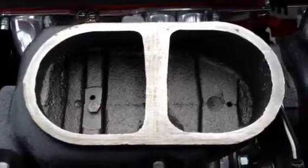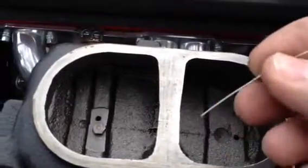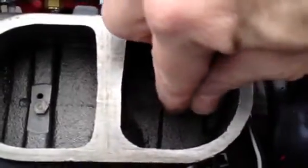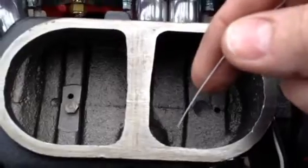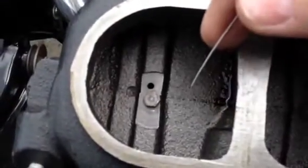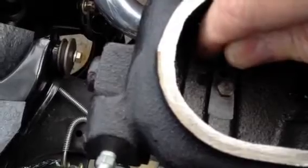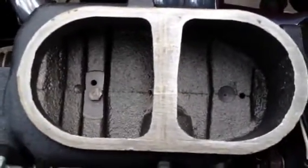So what you've got to do is if you have that problem, get a turkey baster and suck the fluid out of the master cylinder and take a little wire — it should be about 20 thousandths in diameter. Then you stick it down inside that hole and clear the hole out. It's not going to rip any seal or anything unless the seal was parked behind that hole. Use something like a bread tie or a wire that comes on a tag. You don't have to suck as much fluid out if the master cylinder is newer, but stick the wire in the hole and clear it out. Sometimes it gets clogged, or if it's new, maybe it got closed back up when it was machined — and that happens quite often.